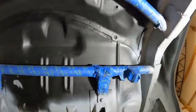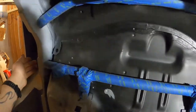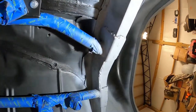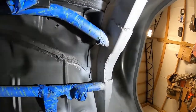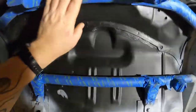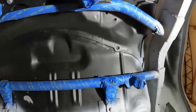One thing I haven't covered much was this rear cradle from Ride Tech. I have this four-link cradle and it came with bolts — they were just some self-tappers that go up into your frame rails, and I did not like how they held. So what I did was get this thing up into place and just welded it in. I figured that was going to hold better if you're throwing a little bit of horsepower and torque at it — rather be safe than sorry. It's a nice powder-coated piece and I have it all taped off. When I Raptor line it I'll just peel that tape off and it should be good to go.